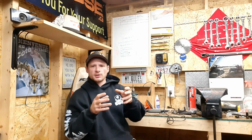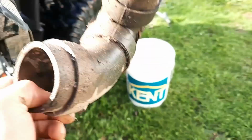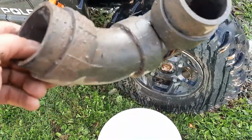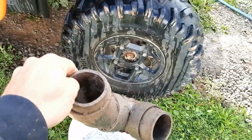The only problem with it so far was the belt exhaust tube. The pipe fell off twice during normal riding, so on the third time I put some PVC glue around it, put it back in, and haven't had a problem with it since. The last time I noticed, I opened this, and the pipe's just sitting right here. Look at this, all full of gunk, from my last ride yesterday. I can just imagine what probably made it into my belt housing again. So definitely, if there's one piece you want to pay attention to, it's this piece here for your belt exhaust. This is the second time now that it comes out on me. So we're definitely going to have to do something with this and possibly even glue it in to help it stay.